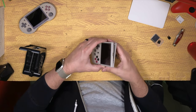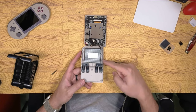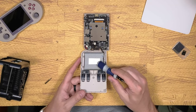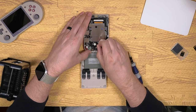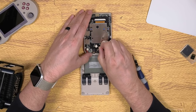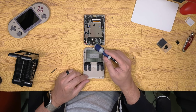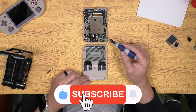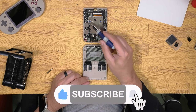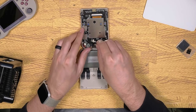You can start at your TF2 card slot and slowly work your way around until it's free on all sides. Be careful not to lose your side buttons as those will fall out. Once open, you'll see the battery, and you can follow the cable to where it's connected to the motherboard. Make sure you don't have any static buildup in your own body before touching the motherboard. Then gently wiggle and pull the cable free from the socket. While you wait 10 to 15 seconds, you can check out the other components like the rumble motor for force feedback, the HDMI out port, the trigger button rubber membranes, and the mono speaker connection.